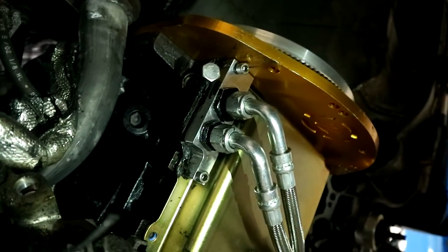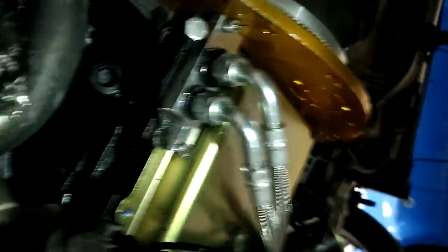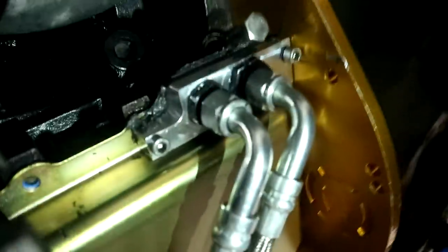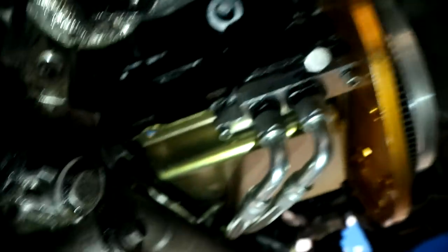That's pretty much hand-snug. I'm going to wait an hour, two hours, maybe tomorrow, then tighten it all the way down and put some oil in it and see what happens. If it's still leaking, my guess is there's a part on the block where it's kind of separate and you're supposed to put some RTV there on LS's. I did put RTV there but maybe I didn't let it cure, maybe it had some oil on it - something stupid like that. I had to drain that oil anyway because it was bad, but that goes for now.